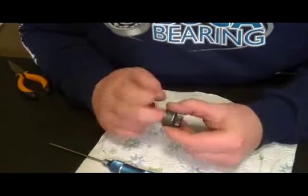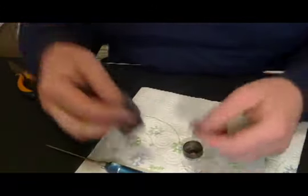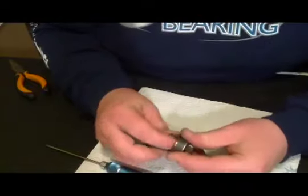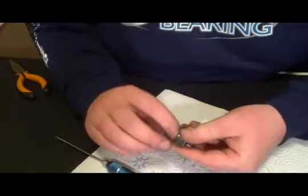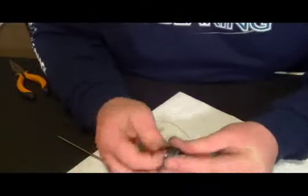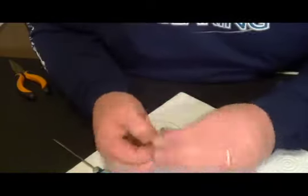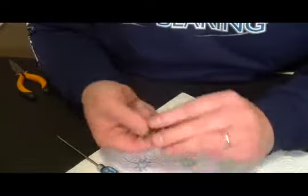Using aluminum shoes is going to leave a residue inside your clutch bell — you can see some dust coming off on my fingers. So we're going to use some standard 80 grit sandpaper. I like to try and find the thinner stuff out of the rolls — works pretty good to keep a batch in your toolbox. Just rip off a piece and run it through the inside of the clutch bell. Try and get it nice and smooth and get all the aluminum stuck to the sides out of there.